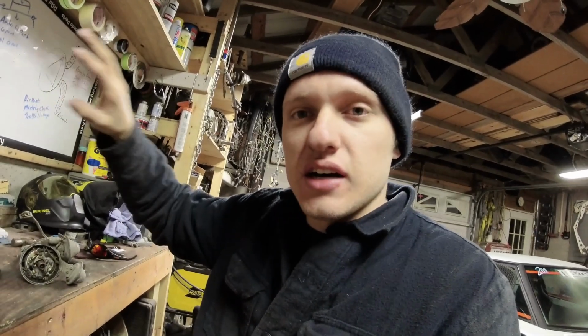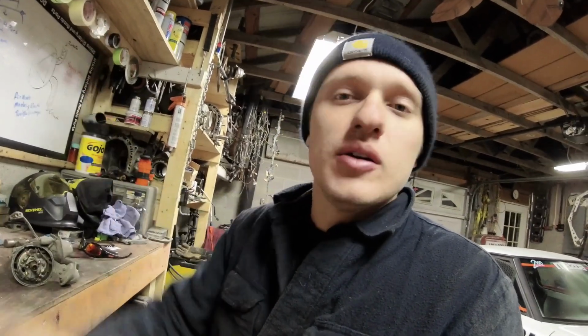There's three different distributors that you're largely going to see in a first-gen RX-7. Okay, I'm going to kind of ignore for now the twin dizzy stuff and the super old school stuff. The 79, 80, and then from 81 to 85 distributors. That's what we're talking about.